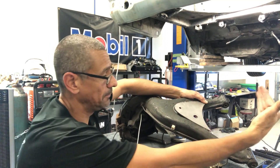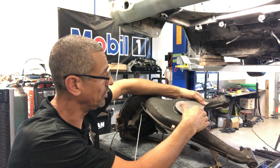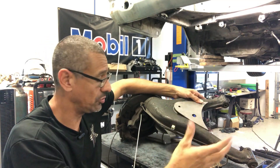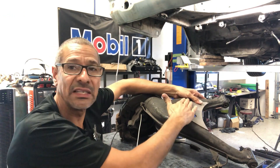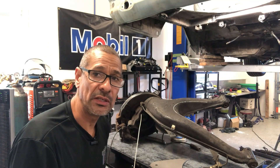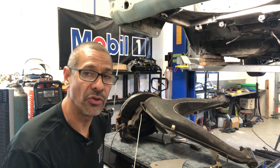I'm going to start my weld from the inside of the control arm and work my way out. As I tack weld I'll start tapping it down and bending it so it sits nice and smooth. I've seen other people put it a bit further down to give it a step, but GarageX shows their E30 and Z3 arms welded up here to give a smooth surface below, so that's what I'm doing. I'll grind and clean up all this rubber coating, get it tacked, pull it into place, do the full weld, then work on the strut brace tube.